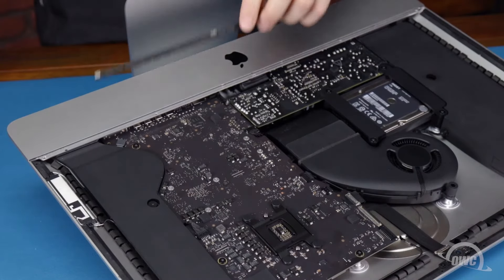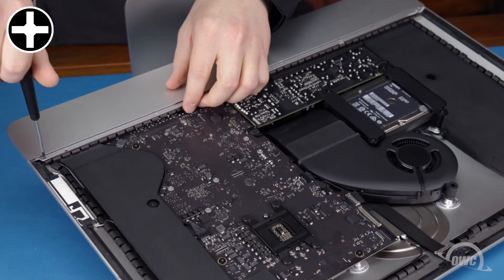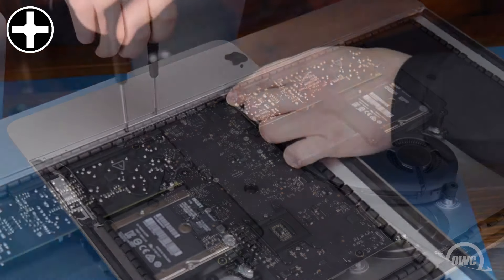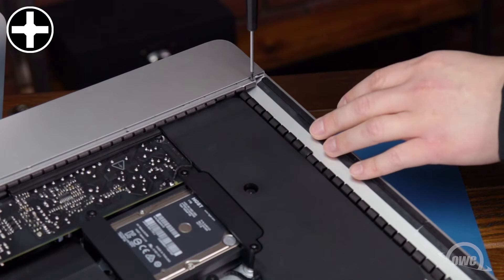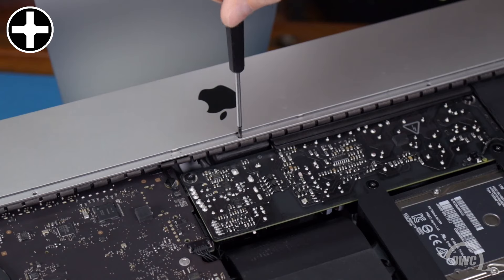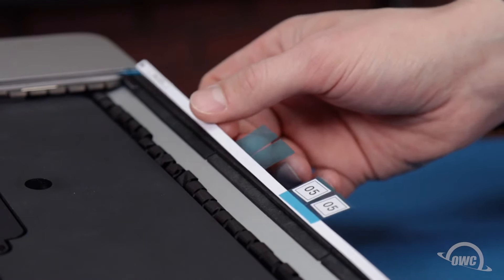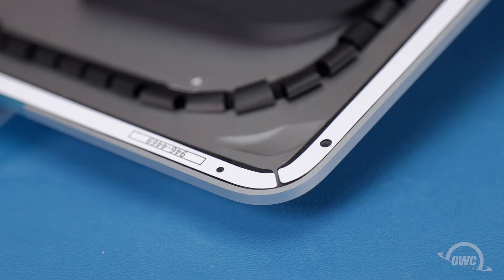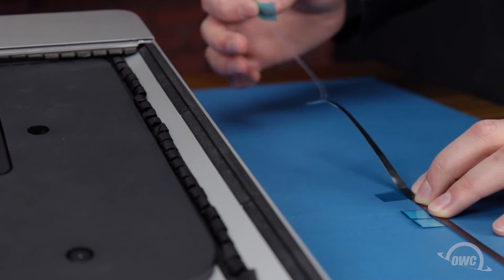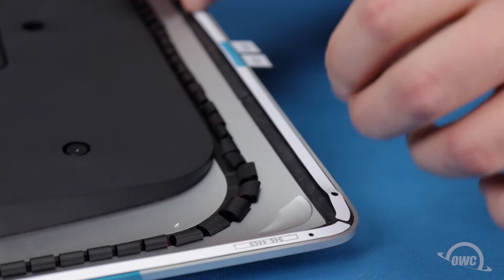The last thing to replace is the strip along the bottom lip of the iMac. Take one of the longer Phillips screws and attach one of the corners, rotating the strip into place as you tighten the screw. Then use the remaining longer screws to secure the other points, skipping the one in the center. The center hole can then be secured by the shorter screw that's remaining. We're now ready to close up. Set the display tape pieces in place according to the diagram that comes with the kit. You'll know they're positioned correctly if all the holes and cutouts line up with the shape of the iMac chassis. Once all pieces of tape have been placed correctly, peel off the backing and adhere them to their places. You can help line it up easier by inserting a pointed object through the hole in the tape and using it to line the tape up with the corresponding hole in the iMac chassis.